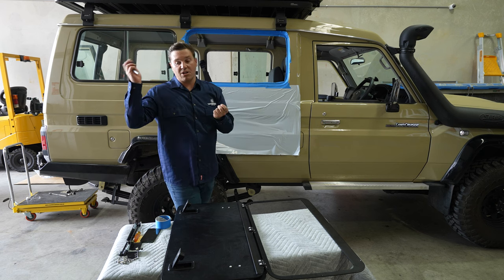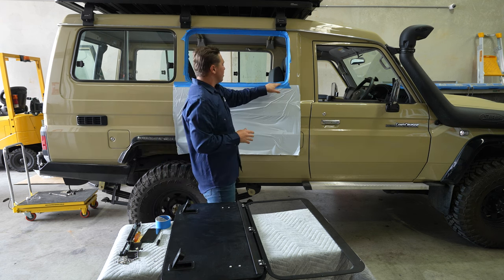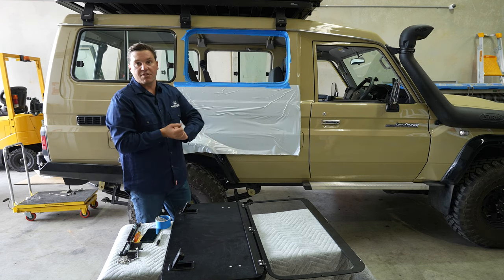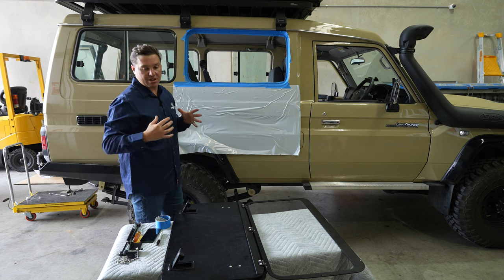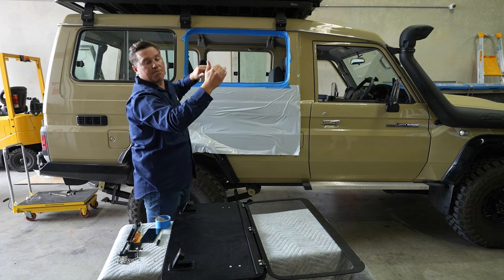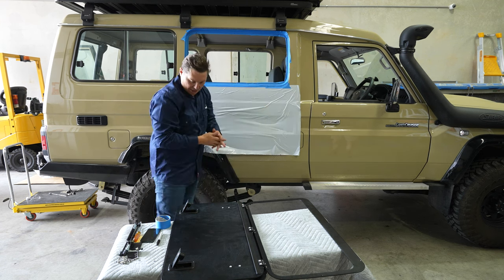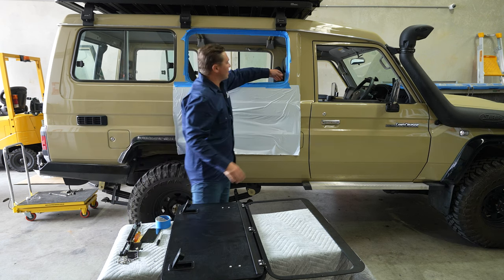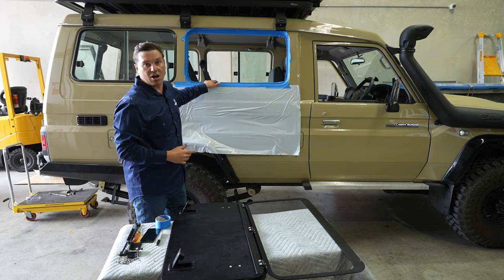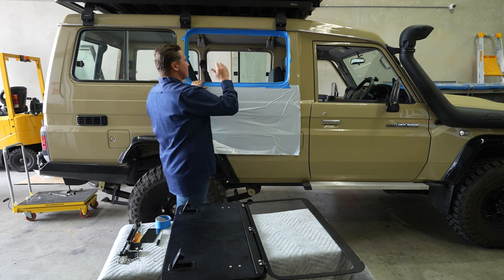Gullwing's prepped and holes are marked. Now I'm going to get a four-mil drill bit on the cordless drill, take my time nice and gently, and drill out the top, bottom, and side holes. Then I'm going to tap those with an M5 tap. What that allows you to do — especially if you're working alone — is grab the gullwing, put silicon around, and really easily sit the gullwing on and sandwich it in. You'll notice the bottom holes have a bit of clearance clashing, but you need that for the clearance on the gullwing. Just drill as close as you can — there might be a little half-hole, but that's no problem as long as we paint all the holes after tapping to keep any rust out.